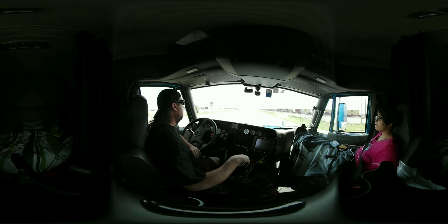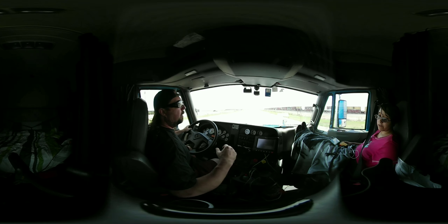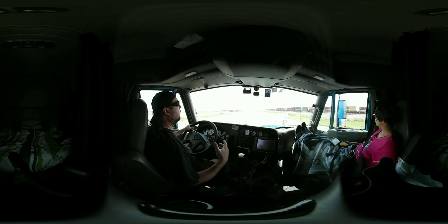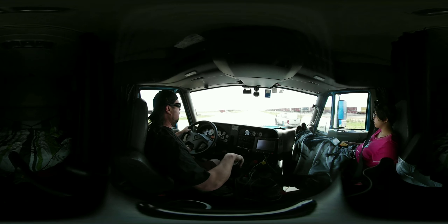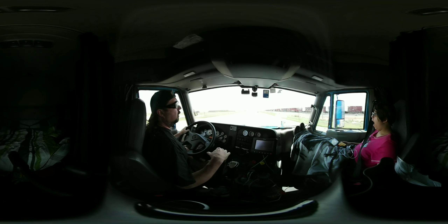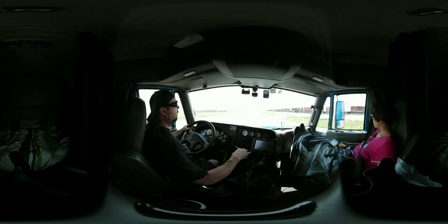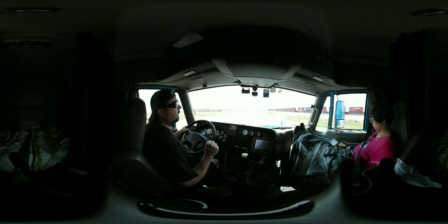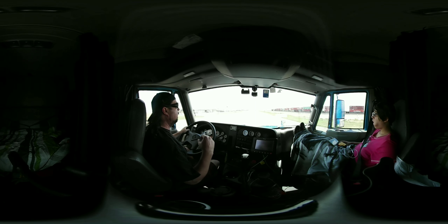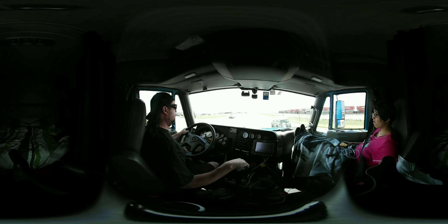I had to do some quick shifting to get out onto the highway. I do have traffic coming — it's kind of busy this morning. I just flipped the pre-select up and I'm in high range now. These have two ranges: low range, which is your first five gears, and high range, which is your last five gears. I'm in seventh gear right now. I get it up to about 1,100–1,200 RPM and I shift. The shifts are kind of quick on the low range and a little bit slower on the high range — you want to take about a second between shifts. If you try to shift too quick, it'll grind. These are unsynchronized gears — you have to time your shifts. Ninth gear at 1,100 RPM, and right down into 10th gear.